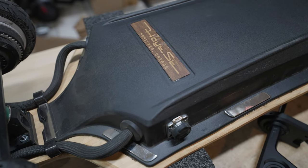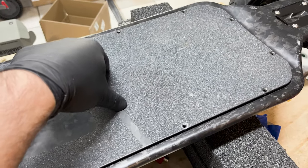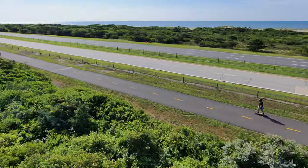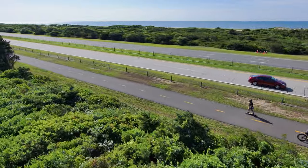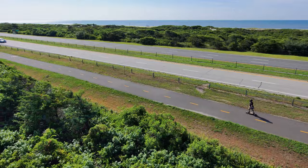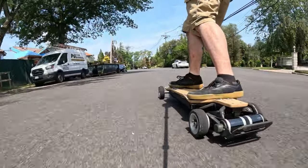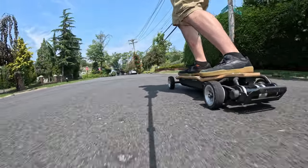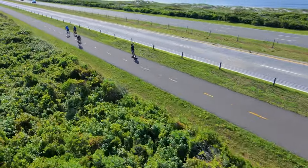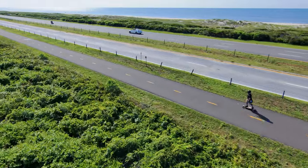Also, this battery and enclosure are properly designed together, so they fit perfectly without any fitment issues — which is more than I can say about another 12S4P board I had in the shop not too long ago. While the board is relatively compact, it does not lack in power or punch. The enclosure's space is used effectively, and there's enough in this machine to hit way above most of the current hot ticket items in the import production e-skate market. The board pushes about 200 motor amps, and with the VESC's smooth power delivery, you get consistent power that does not disappear above 15 miles per hour. The board ships with settings that can outpace most of what you're likely to encounter on a group ride, but will still keep the board working at a level where it's not going to burn itself out.